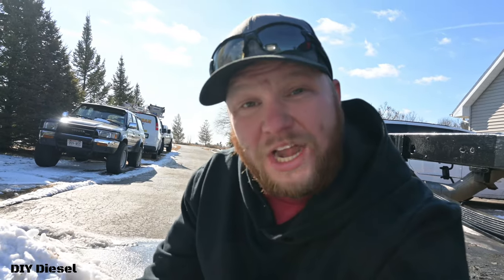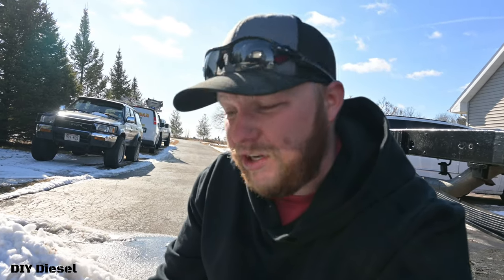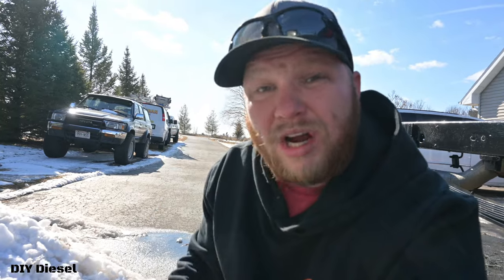I'm going to go ahead and do it on all my studs right now — you're basically going to watch me do it. It's a really good thing to do, especially if you just want to do this occasionally when rotating your tires, just to clean out some gunk and grime in those wheel studs and avoid stripping out your wheel stud when you put your lug nut on.